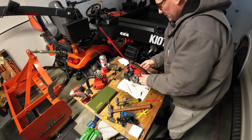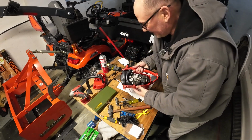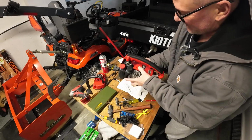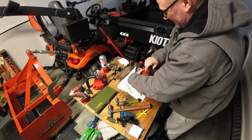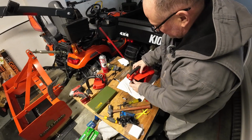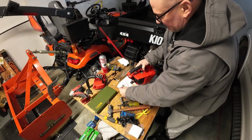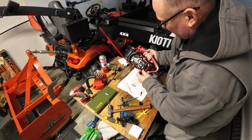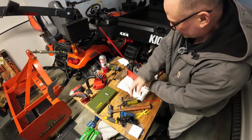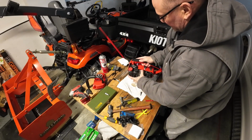Ooh. Hold on a sec there, Mike. Can anybody tell me what the crucial thing is that I forgot? I didn't put the new bar stud bolt in. So, let's take the spark plug back out, and pull it back out of the case. Take our wire back off. Well, we're definitely learning how to assemble this fairly quickly, aren't we? Pull it back out of the case.